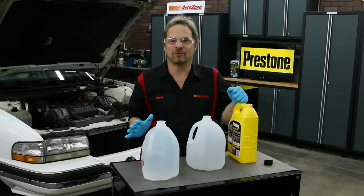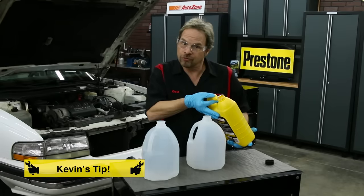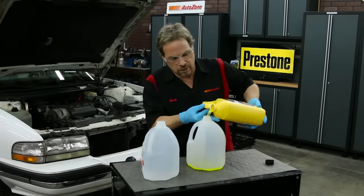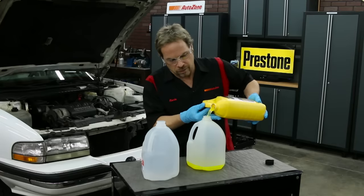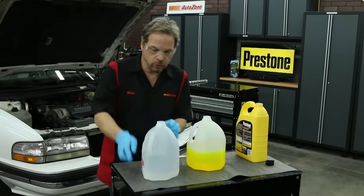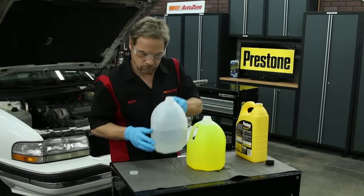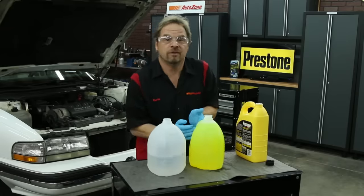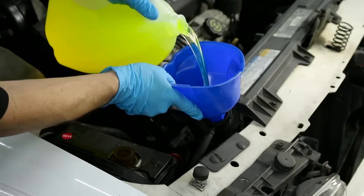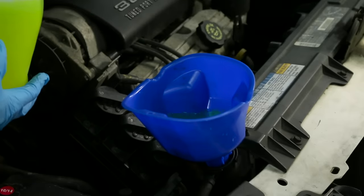There's an easy way to do this — you don't have to play Mr. Wizard. Just take one of your old distilled water jugs and pour it halfway up with the Prestone 100% antifreeze. Pour from the side so you get the right water displacement and don't get any spillage out of the top. Pour up to the halfway point on your empty jug, then fill it the rest of the way up with distilled water. Now we can start the car and it'll pull the rest of that down in there.